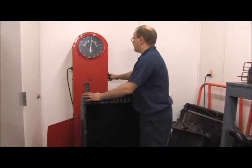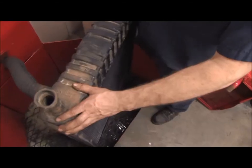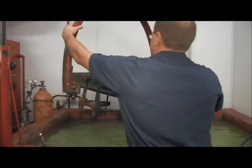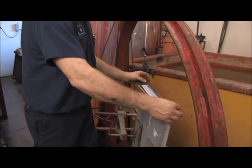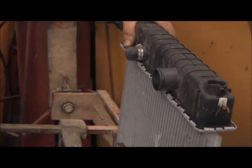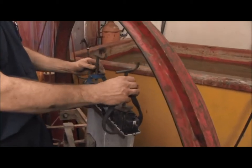Flow of the unit is then checked if requested by the customer. If the flow is determined to be bad, we recommend tank removal and rodding of the core. If the flow is acceptable, the unit is then placed in our hoist and pressure checked within our test tank. Any leaks found will then be repaired. More common today are aluminum cores with plastic tanks. Aluminum is more difficult to repair than the older style of brass and copper, and many times aluminum radiators are replaced rather than repaired.